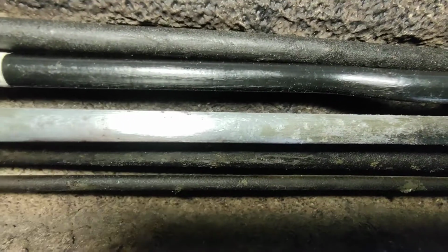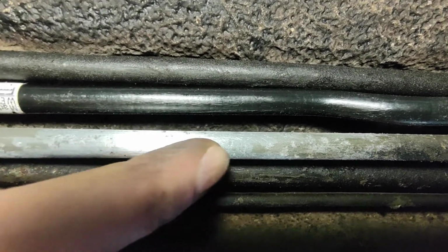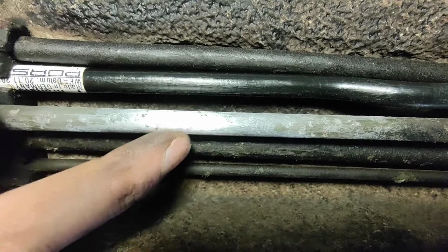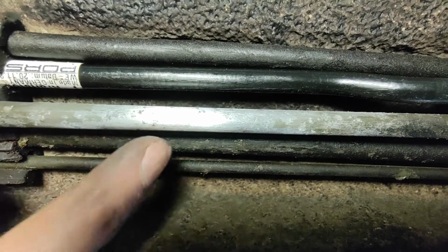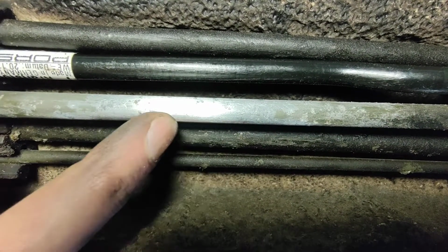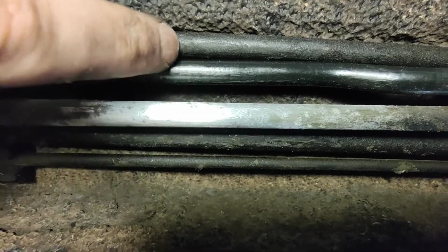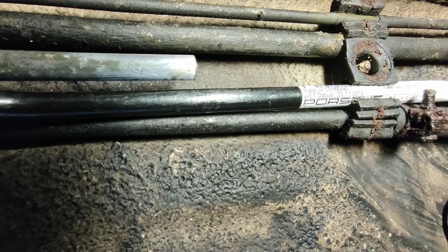So welcome back to underneath the car. I've been cleaning off the original fuel pipe that we're going to connect to with some emery cloth, looking for a nice sound bit with as few pits and things as possible. So I'm going to cut this pipe off right about there, where there's some nice clean metal either side. Then we'll be able to measure the new pipe and cut it accordingly. Okay, so that cut very nicely.